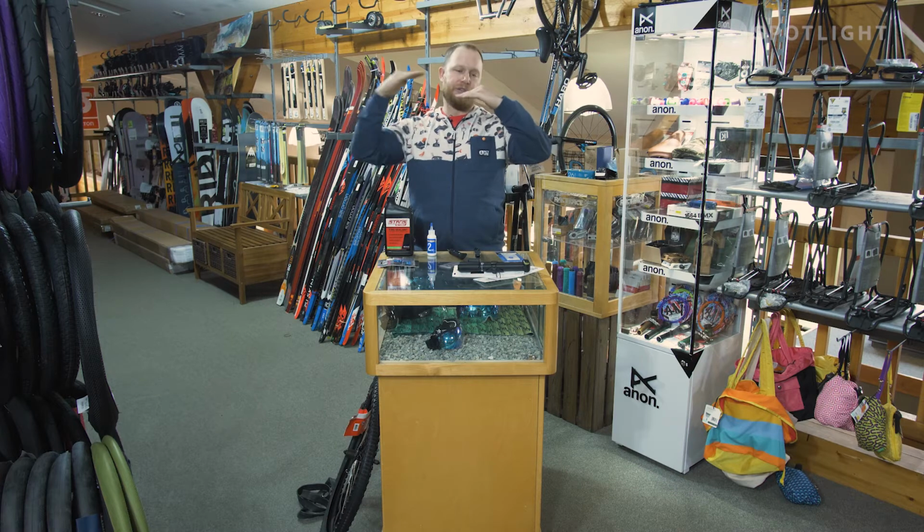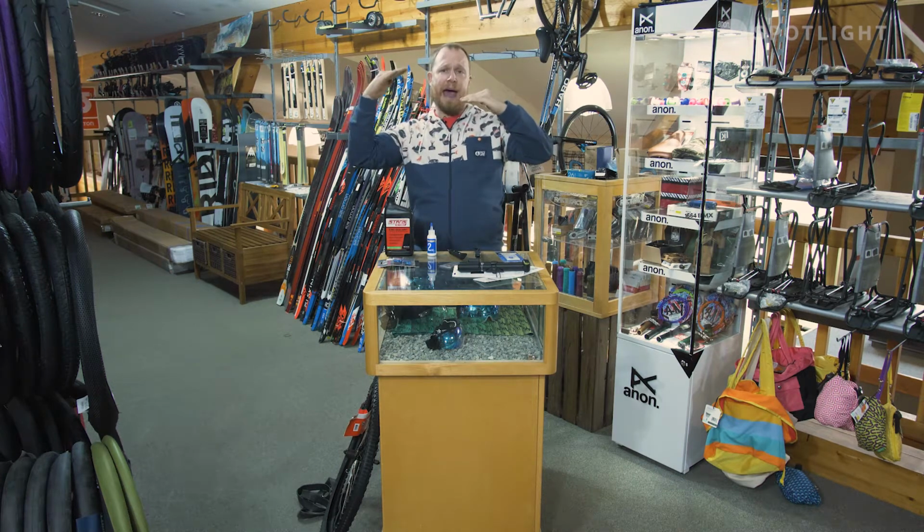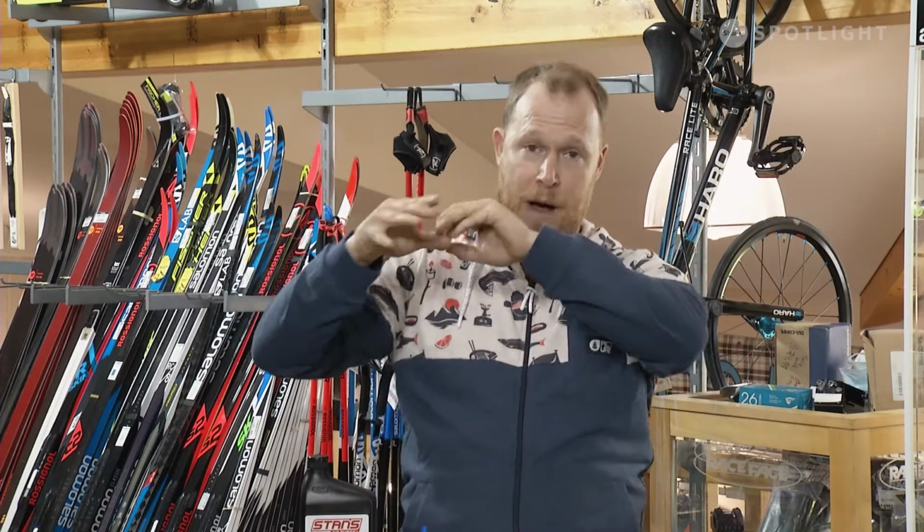Negative feedback is when your tire hits something, and if it's got a lot of tire pressure, it's going to bounce back. So you get negative energy moving in the opposite direction that you're trying to move. If you run lower air pressure, the tire can actually conform over top of the bump and roll over it without incurring negative feedback, which is much more efficient and faster.